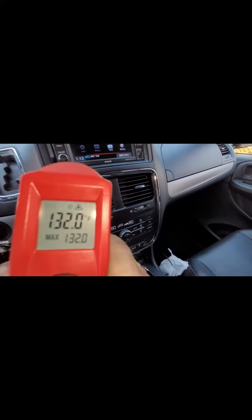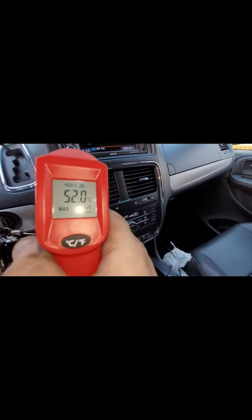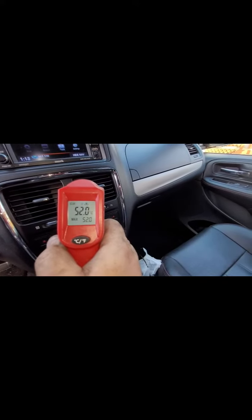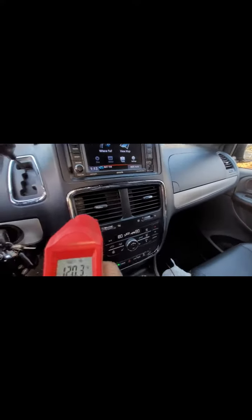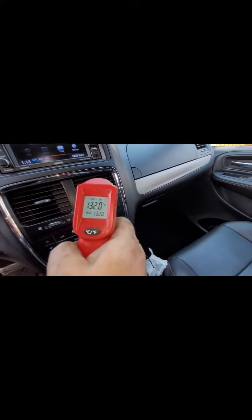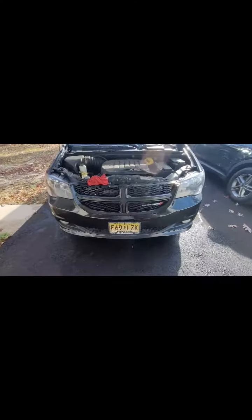I just want to see the temperature of the heat coming out — we should have done it before and after, but we didn't. It's showing around 131-132°F on one side, 128°F in the middle, 123°F on another. It is hot. So there's just a couple degrees difference here and there between sectors, which isn't a big deal — even though both sides are set to 80 degrees with the fan all the way up.